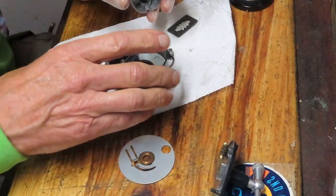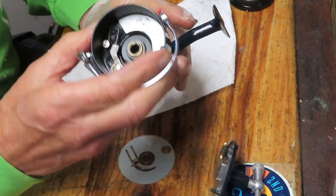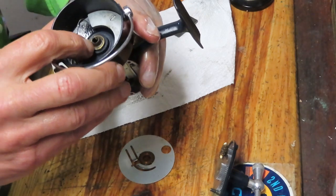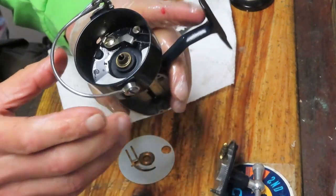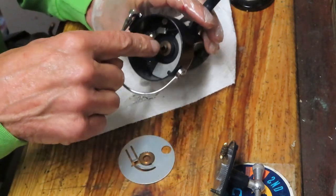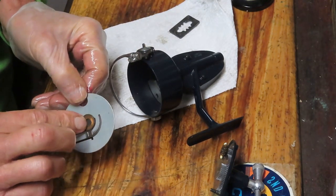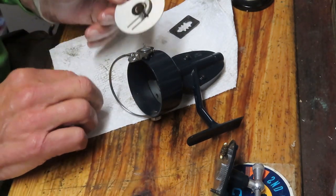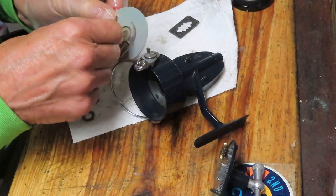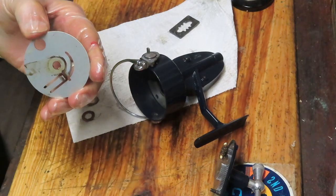Be very careful with that roller bearing when putting it back in — if you knock those bearings out of alignment you'll have difficulty reassembling. Slide it down keeping your finger on the roller bearing. The first piece you wiped off is the shield for that bearing. Then you have the baffle plate, two copper shim washers, and a metal top washer. Take those off to clean the back of the baffle plate.